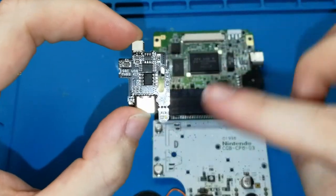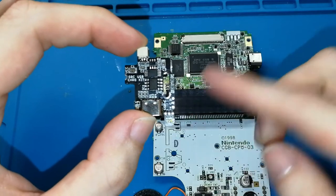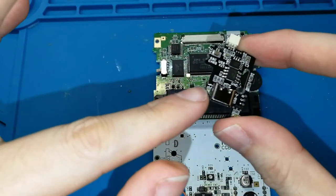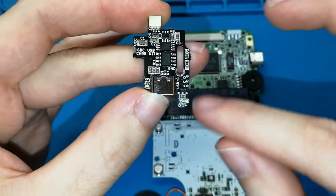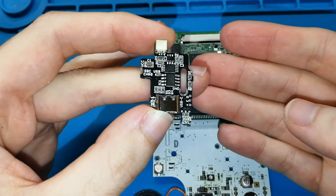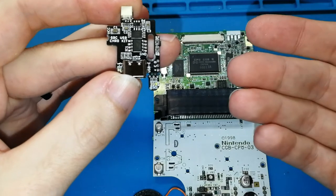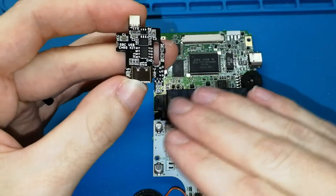We will solder this board. Please don't cut the light board yet. Maybe it's good for you. In the first, second and third version of this board, I think, the main board doesn't include lights. But this one, yes, so maybe it doesn't matter if you cut now or not. But in the first version, you don't have another way to know if you have installed the board well, okay? So it's better if you keep it here.